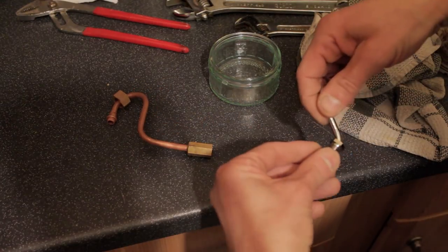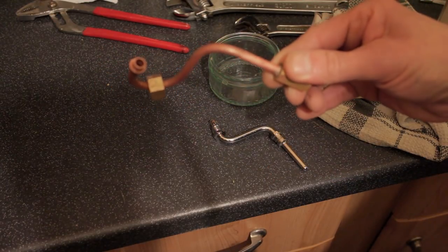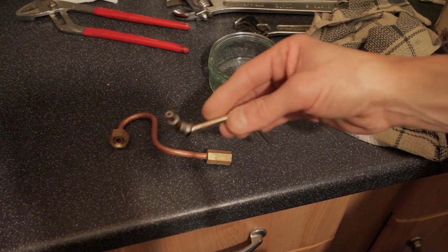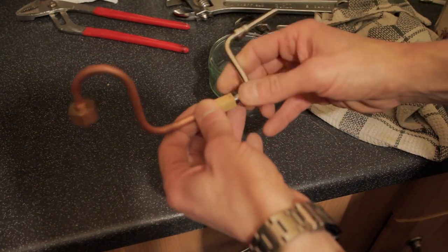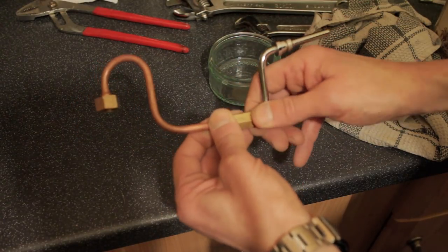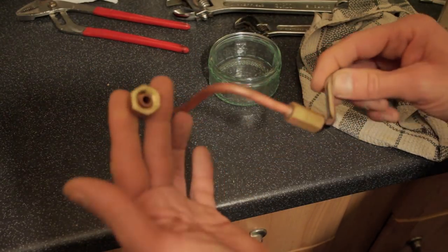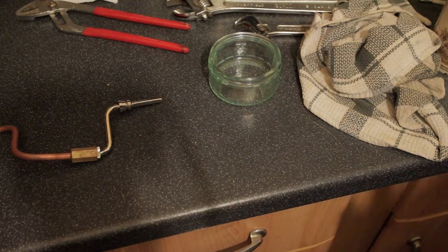In the meantime, let me show you some of the other components. This is the steam arm assembly - you probably can't see the inside of it, but that was pretty grotty-looking and now it's nice and shiny on the inside and outside. I've done the same with this piece - the O-ring sits on here like so, this slots into this part, and then tightens up here. You need two 12mm spanners to nip that up, which allows it to swivel, and then this feeds back into the assembly and onto the top of the boiler.